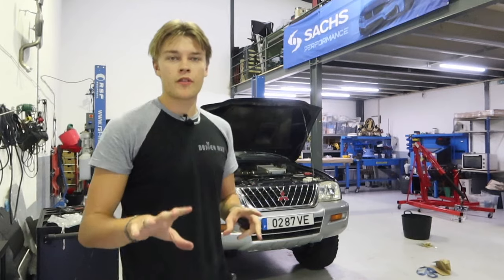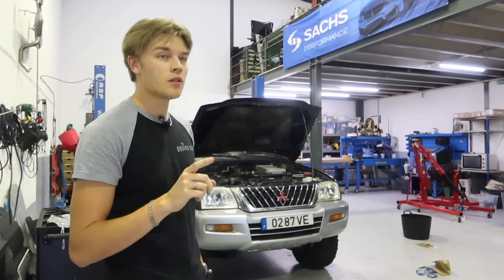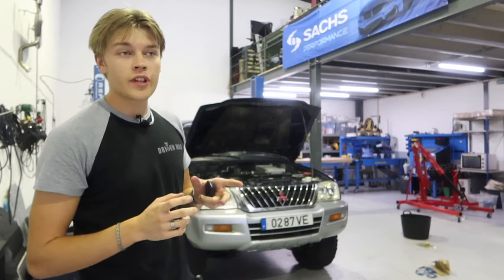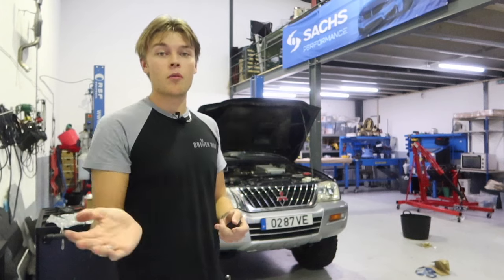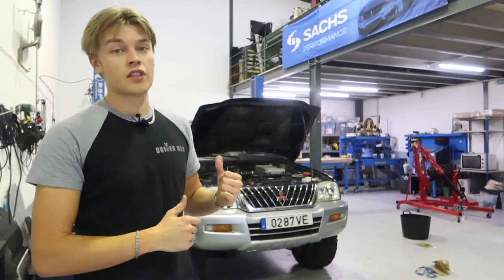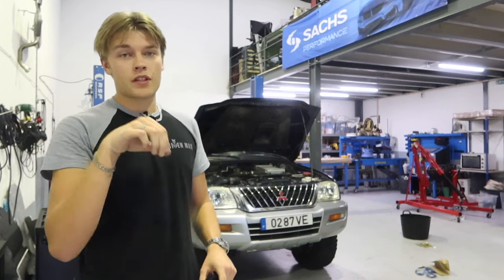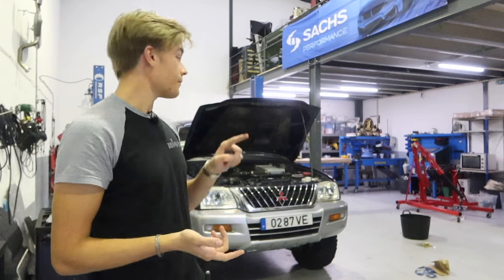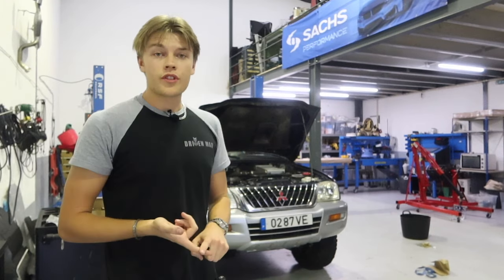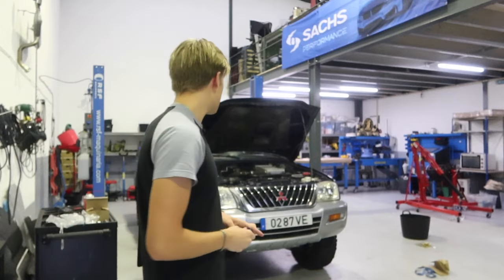I've unplugged my microphone so you can hear the engine. I'm very optimistic. I've installed a boost pressure gauge on the dashboard so I can see how much boost I'm getting. I'll see if this has fixed the over-boosting pretty quickly. Hopefully we don't get any engine codes — I know if the solenoid is faulty you can get an engine code. Also I'm hoping I've got the lines around the right way. Fingers crossed it's all good.